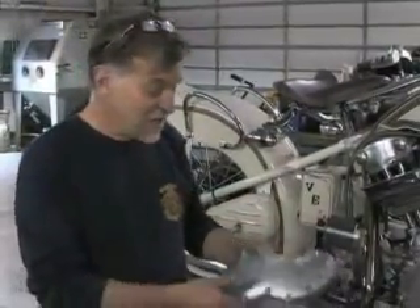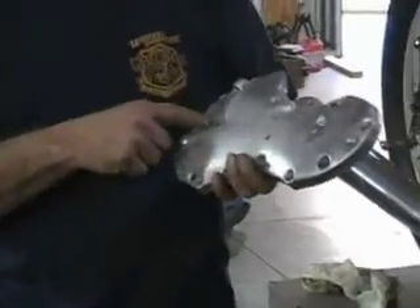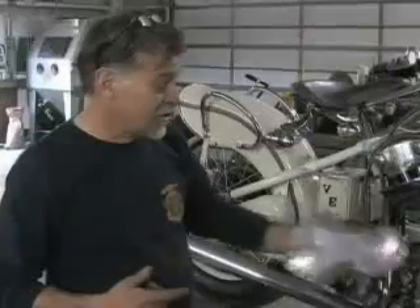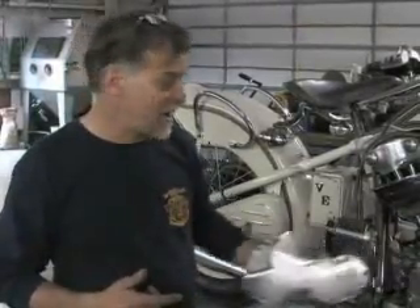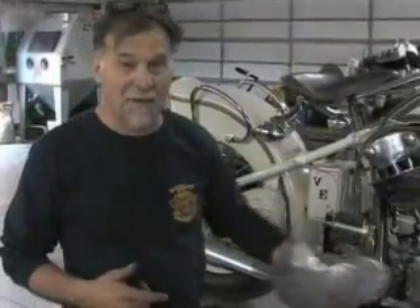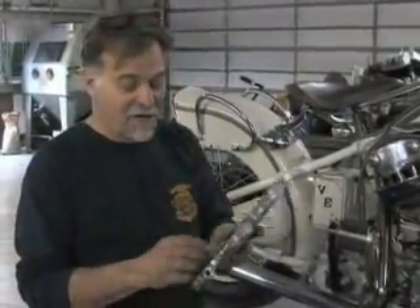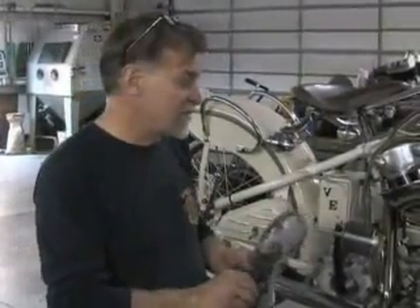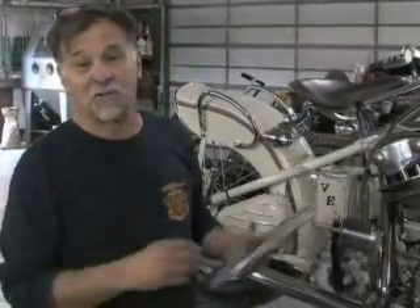Short history on 36 knucklehead cam covers — I'm not Chris Haynes, but I do know a little bit about these machines. The version of cam cover we're putting on is the early version, and the 36 knucklehead collectors and freaks around the country all really admire this cover. We're going to be removing the current cam cover and installing this one. I've already made a measurement to ensure the cam end play will remain the same — it really shouldn't take too long, estimating about 15 minutes.